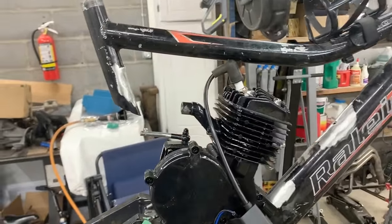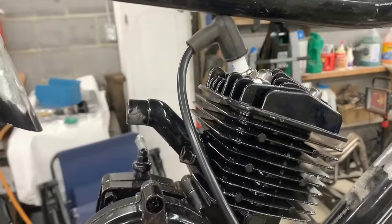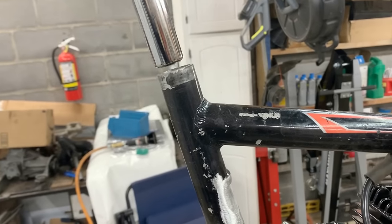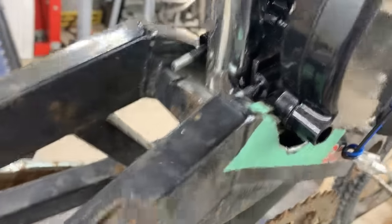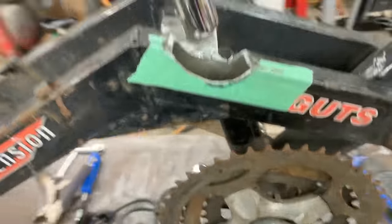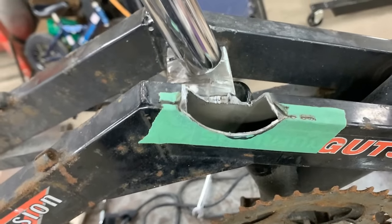Well, that helped a little, but not much. It fits there, but if we need to remove the spark plug, we can't even take the cable out. And also here, this is not really easy. I found a different pipe, and I put it there, and it fits perfectly, but we're not gonna be able to put this bracket and the nuts. I think we're gonna have to drop it even lower. This means we have to shorten this pipe, or at least notch it so this bracket can go even lower than where it is now, because now it's limited by this.